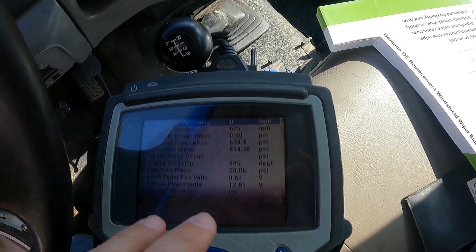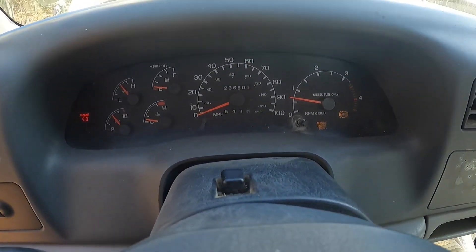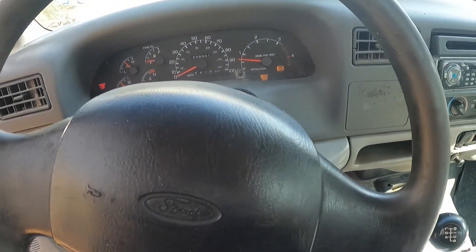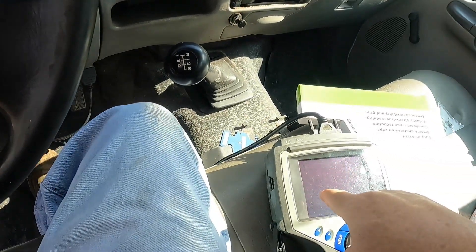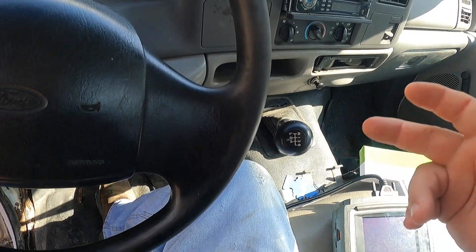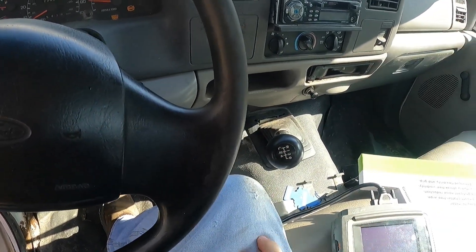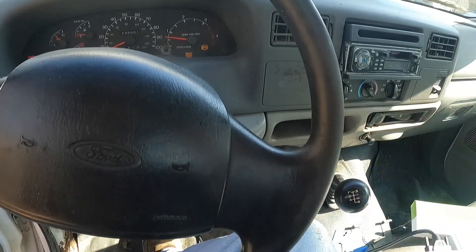There's something going on in there that's temperature related. All our numbers are looking good now, she's idling well except for a little rough idle. I verified this yesterday by doing this test twice - I took the cold air off, let the truck run 10 minutes, it died, wouldn't get any ICP pressure. Put the cold air on it a second time and it fired right up. I have done this where I've just changed the coil and not the whole IPR and that has worked, but this truck also has an RPM problem so I think the IPR is sticky as well - on this one I'm going to change the whole IPR.